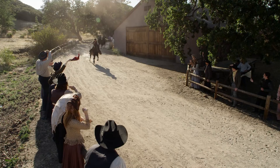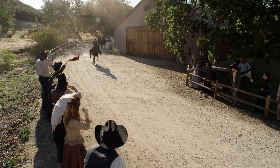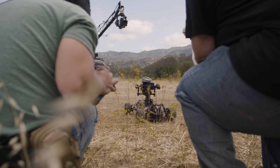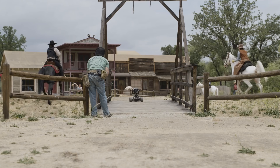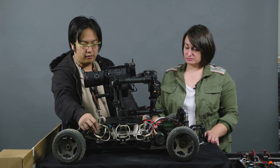Some of the stuff that we learned: first and foremost, dirt roads don't let it grip very well. The way we counteracted that was we added the weight here to bring the center of gravity down a little bit more. And for shots where we needed to start off quickly without spinning the wheels, we would put a piece of wood or plywood underneath the back tires so that it had a little momentum going. There are three things going on here: you have the shocks of the vehicle, this wire frame additional shock mount, and then the gimbals themselves holding it in position.